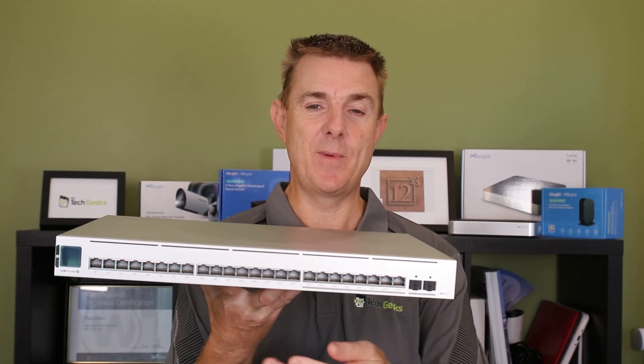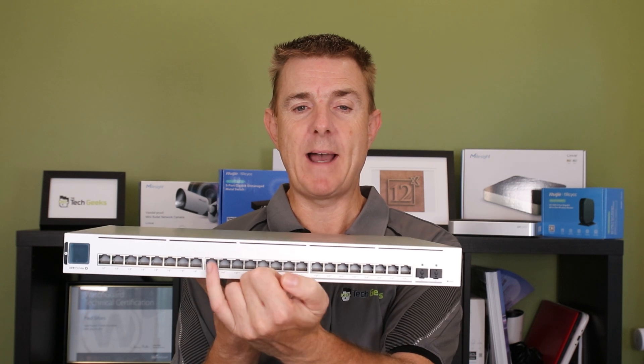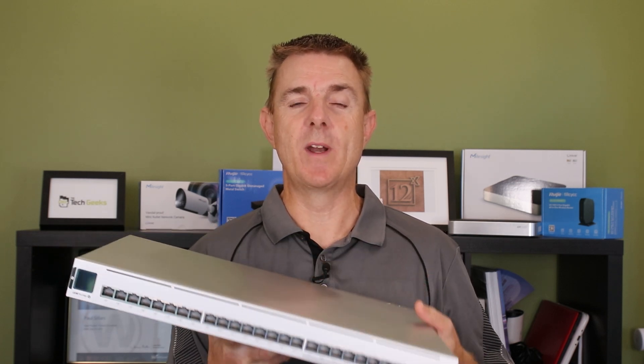This is one of the first range of switches — although it has upgraded switch ports — that actually has coloured LEDs in it for easy identification. The idea is that you'll actually see a white panel at the back of each port that lights up and can have multiple different colours. So you can assign colours to VLANs, to PoE ports. There's a range of cabling called ether lighting and the light shines through. So you can walk to your rack and see very clearly what switch ports are configured for what. Just another visual way of making this all work.